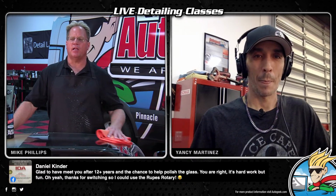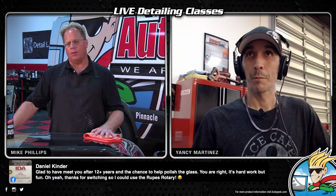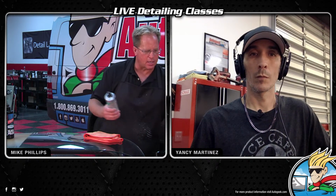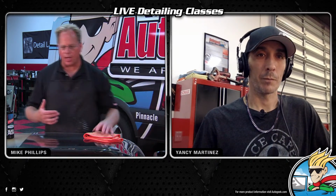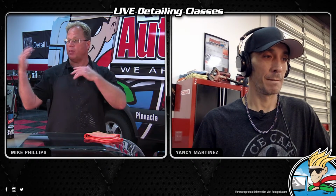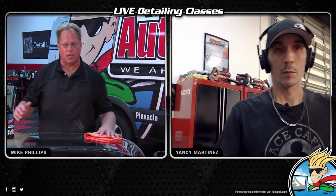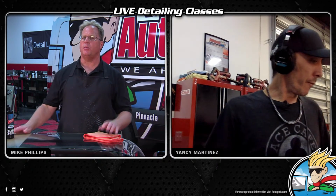The class I taught, I think they were running 40, 45 minutes. What we did is we put a tape line diagonally down the passenger side of the window, and then we used the cerium oxide in a glass pad. Because it's a fairly short class, I buffed a section just enough so you could pull the tape line off, and anybody looking could say, yes, that is a huge before and after difference. But what that meant was all the rest of the glass had scratches. And I'm busy working on this and answering questions and interfacing with all the people there.